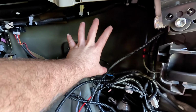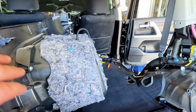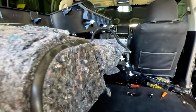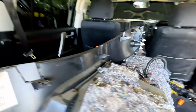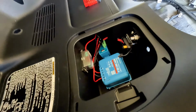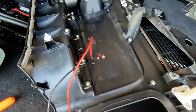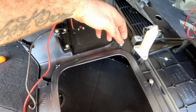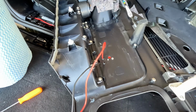That's where the compressor mount is going to go, and the little tank sits just above the fuel filler there to the side. So next step is removing this big plastic unit off the back, which has just got a bunch of screws all the way around, and it should come off. Then I can get the wiring components out and start installing the compressor. Here's the inside of the panel with that section removed. There's a bunch of screws, a couple of them put back in there. 1, 2, 3, 4, 5, 6, 7, 8. 8 screws, and that section gets removed.